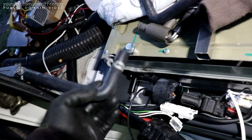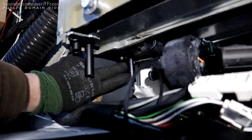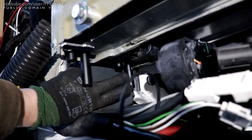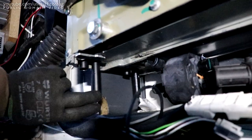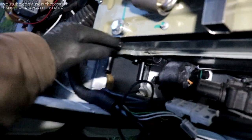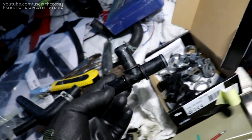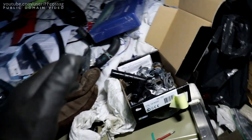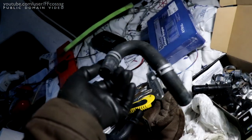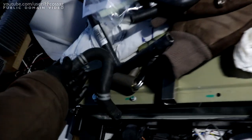To hook this up I have a bunch of angled lines and a ridiculous amount of clamps, adapters, reductions, and T-splitters. The plan is to get a few of these adapters hooked up to put these two boxes in series — outgoing from this module, then into the next module, then from that module into the pump, then into the heater, which makes a nice turn and goes back. Somewhere along the top piece we're going to put a T so we have the possibility of an expansion vessel.